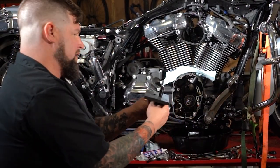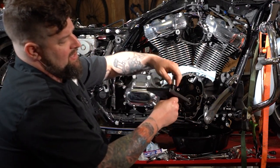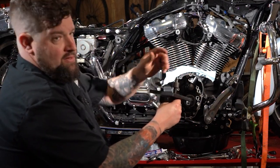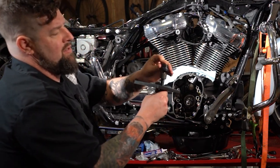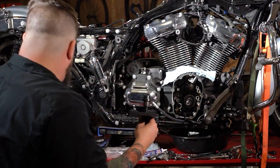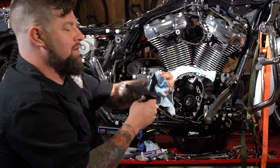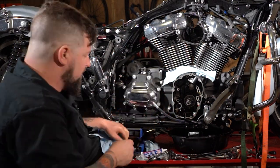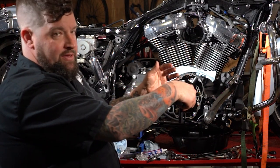Now that we have it started through there, make sure everything's clean. You have this little adapter piece with the threads on it — thread that down on there. Then you have this bushing that the bearing is going to sit onto, held in place by an o-ring. Wipe that off and make sure it is as clean as you can possibly get it. Even if it's brand new, clean it. From there, we're going to take our new needle bearing out of the package — it will slide right down on there.